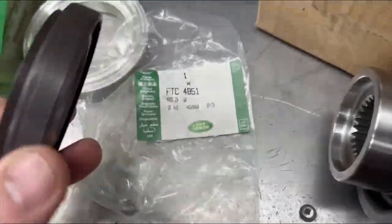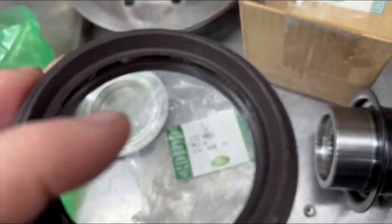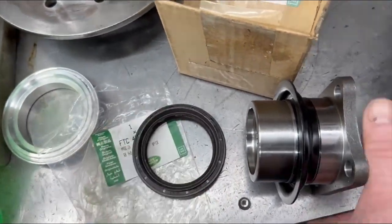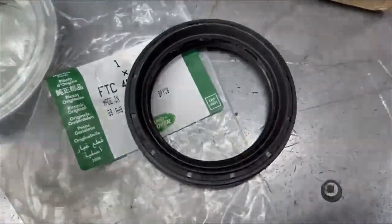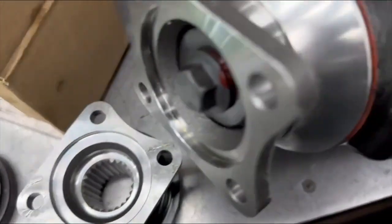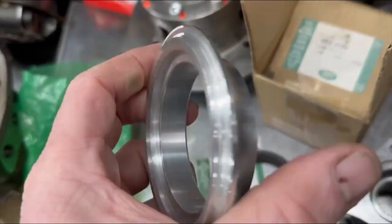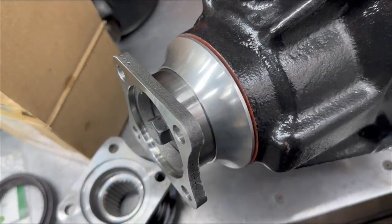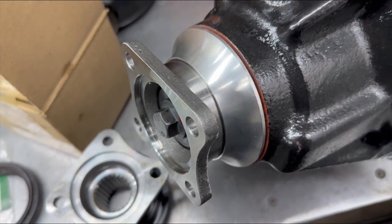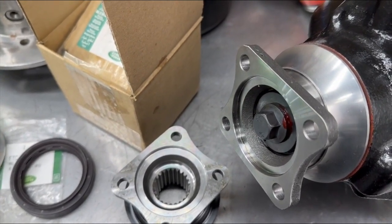The actual seal that we use on the short nose diff is not a bad one — it's a copy of the triple lip seal on the long nose. The problem is that the protection for that is via a tin shield that sits somewhere near the front, and that big groove fills up with mud, which grinds away, and mud and water get in while the oil gets out. So here we have the super flange that we fit — this is so tight you can barely get anything between it and the casing. This is an aluminium billet that we have CNC machined, which fits inside the casing and moves the seal further inboard. It makes a hell of a difference. We do them for long nose as well — we don't build a diff without one unless someone asks. If you can keep the oil in and the water and mud out, your diff lasts an awful lot longer.